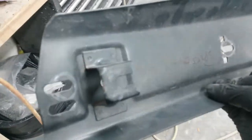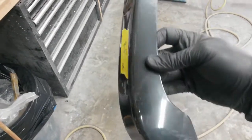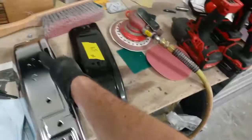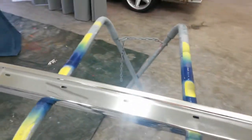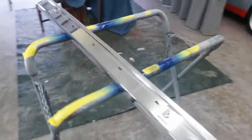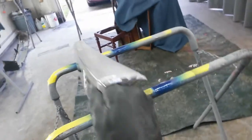This one's still okay — mount's still good, there's really no rust in here — so I'm just gonna reuse this piece. I can just scuff this and prime it, I don't have to worry about the chrome on it. The other one's pretty slick. It's a BMW OEM part. These other ones are aftermarket — both center pieces and the rear corners are aftermarket — so they've got some ripples along the top. I'm just gonna spray it all with epoxy, cover the entire top surface with some body filler, and just block it flat to take some of that out. May not be perfect but it'll be a whole lot flatter than it is now.